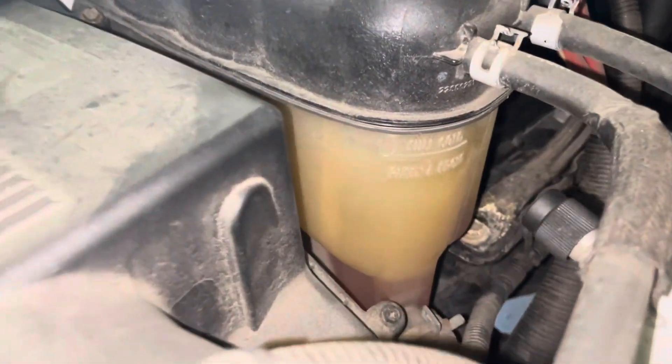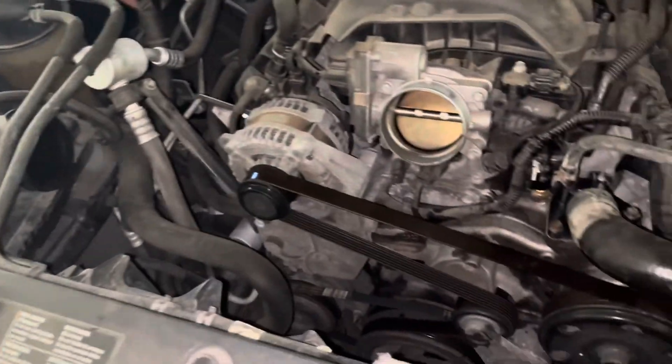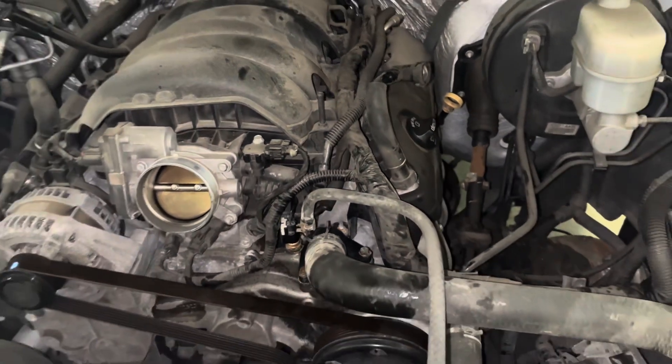The last thing I want to do is fill this tank up to the line with some fresh coolant. With the coolant tank filled, the last step is to put the air silencer box back on. Remember, you're going to attach it to the throttle body, connect it to that air box over there, and then there are those two PCV valves to connect. Let's get that done.